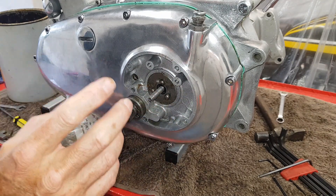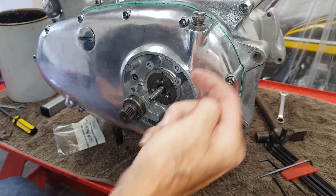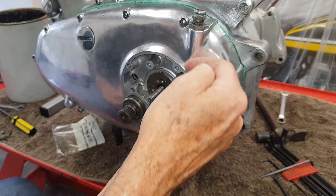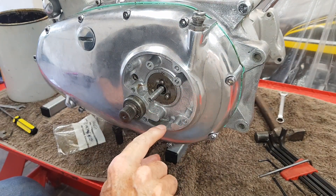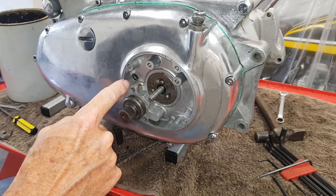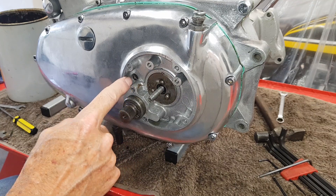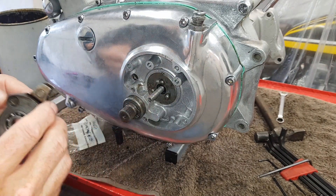Things to note: there should be oil in here. People take this cover off and wonder why there's oil — yes, there should be. The clutch cable actually goes into the primary chain case and then back out through here, so oil will come through. There's also a drain hole here, and a hole used for checking that the gear change foot is exactly halfway across — but it also means oil can come in there to lubricate the whole system.